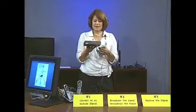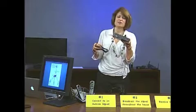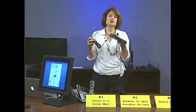This is a modem. The modem connects to the outside world with a coaxial cable — the type of cable that has a sharp pin inside. Your modem connects at one end to this coaxial cable, and the other end screws into the wall where your cable provider has put an outlet. Your cable provider, who also provided this modem, is also called your ISP, or Internet Service Provider. If someone asks who your ISP is, the answer would be something like Verizon, Cablevision, or Comcast — whoever you pay the bill to. So this connects to our wall, fulfilling step one: connect to an outside signal.